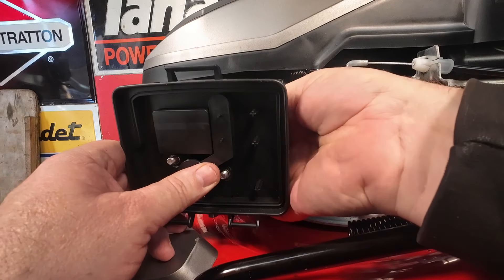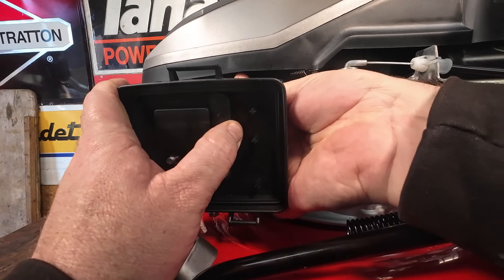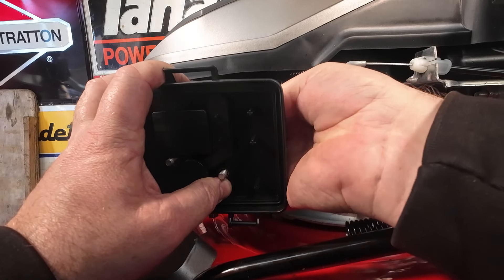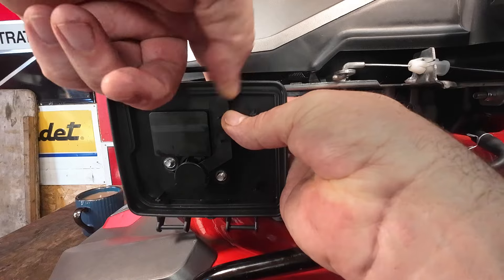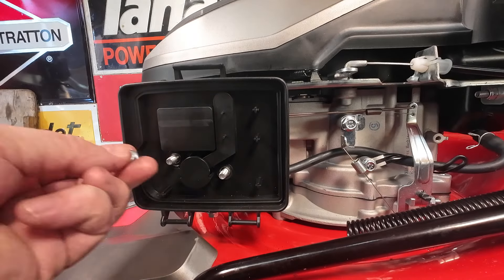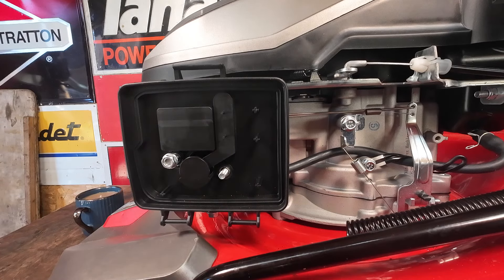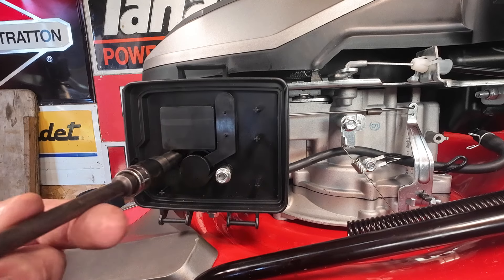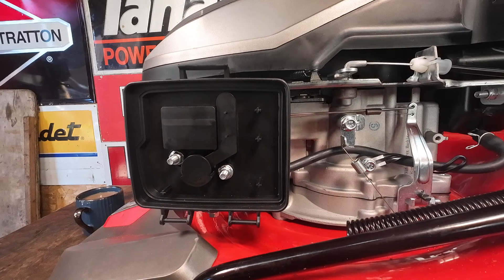I can feel roughly where it's going to go — it needs to go on. It can't just sit roughly on there, it's got to be on. If it's not on properly, take it off and try again. It's just fiddly — these things are sent here to try us. Right, that's now on. I can now get my two 10mm nuts — grab hold of your nuts — and put the two 10mms on there. Then put the air filter back on, and then put the air box cover back on. Not too tight — just well seated.